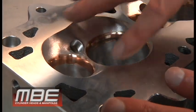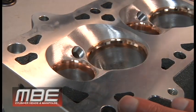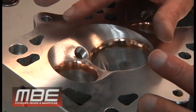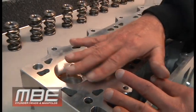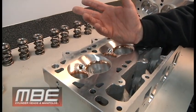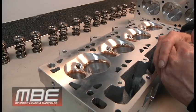The reason why we go down at an angle like this is kind of an industry standard — there are no secrets to it. It's because as the flat of the piston hits there, there's not enough area in that space, so it doesn't burn the fuel properly and it tends to want to detonate, especially with a power adder. So if you leave that open, it'll burn the fuel and it will not detonate.